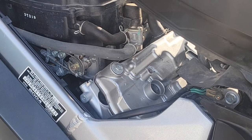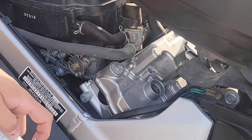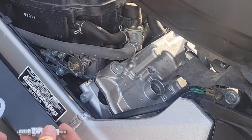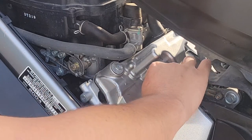Let's go ahead and replace that. The spark plug for this one is the IMR9B-9H — also known as part number 4888. These are pre-gapped, so there's no need to gap them. The way I like to install them: I put my finger down and guide the plug in without dropping it.